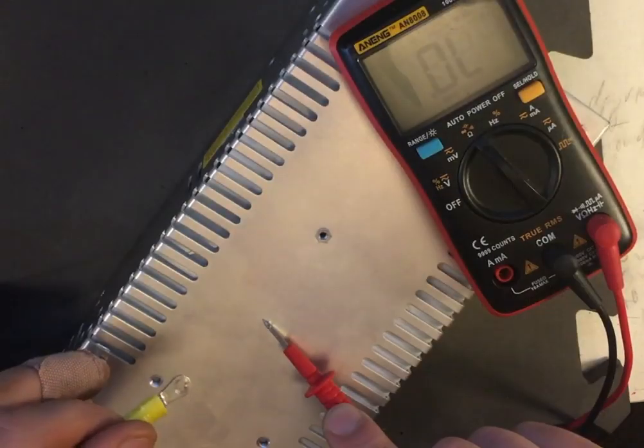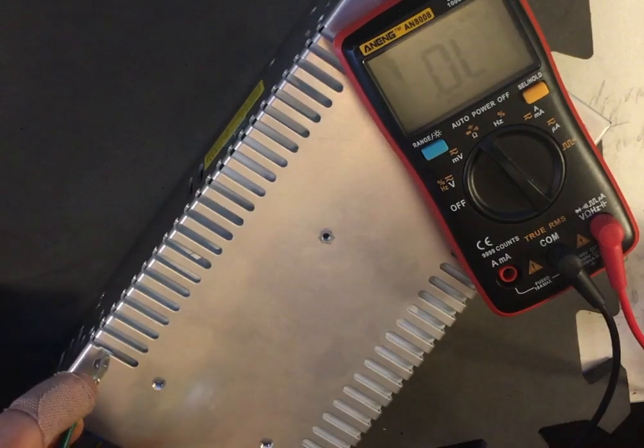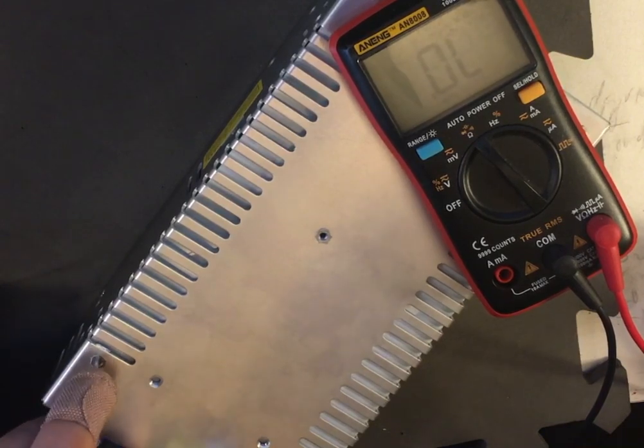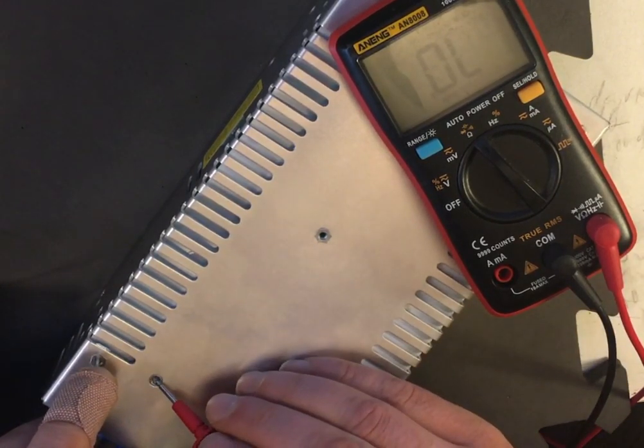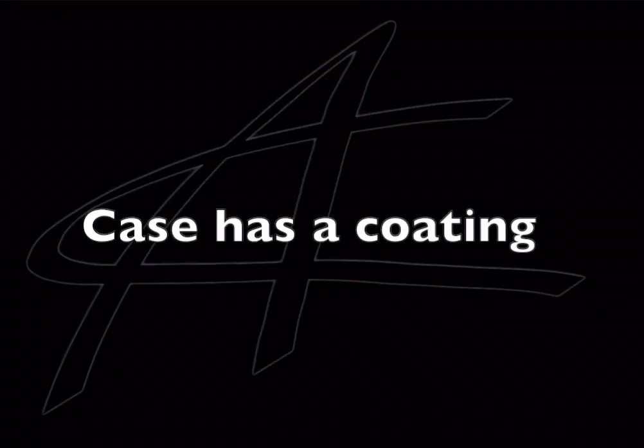As you can see right here, 'OL' means open circuit. I found out the chassis has some kind of coating that insulates it. Testing between the ground lug and the chassis, I have no continuity — but if I connect that ground lug to a part of the chassis without the coating, I do get continuity. That's one layer of protection, but if you touch an exposed part of the chassis — like where a hole is punched — you can still get a zap if there's voltage on the chassis.